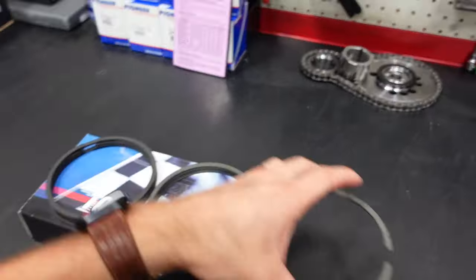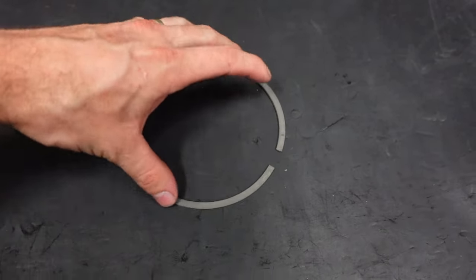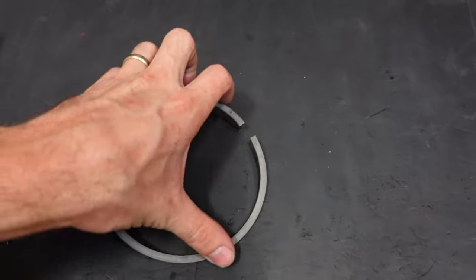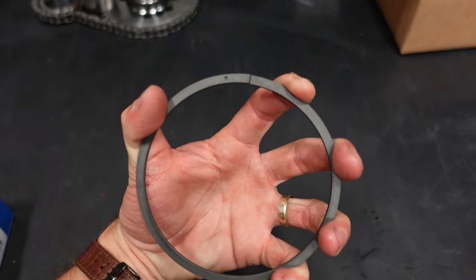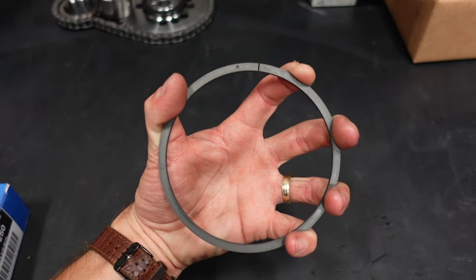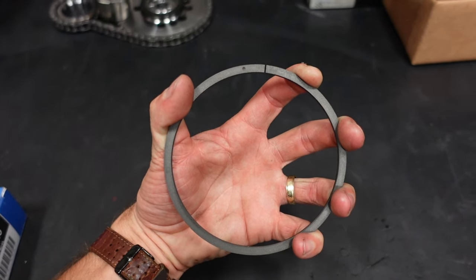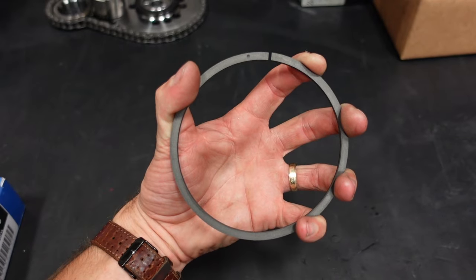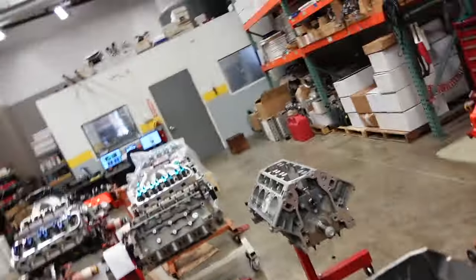Let me illustrate what I mean. This ring is not in an engine and it's a little expanded, but as you can see we have our gap. Once this ring gets put into the engine block, it's going to be squeezed and the gap is going to be very, very small — about 26 thousandths in this engine. What can happen is if those rings ever touch from thermal expansion, they'll apply a ton of pressure on the cylinder bore and they can damage the hone.